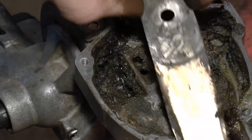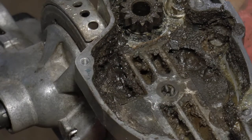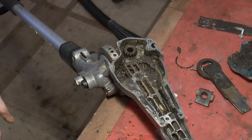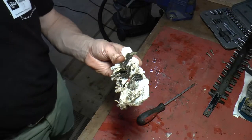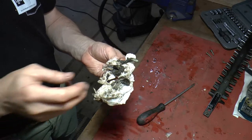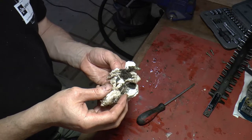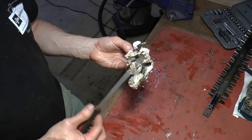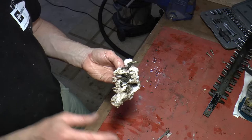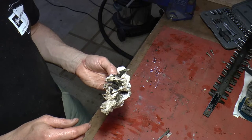This is all quite simple. There's actually another metal plate underneath, so we'll take that out and clean everything up in the parts washer. There are some more bearings that have fallen down in here so we're going to get those out. This is some of the black grease I've been taking out of the gearbox - it's obviously burnt, it's got bits of metal in it. It's supposed to be a nice creamy colour but it's never been changed. I'm scraping out most of the grease with a screwdriver first so as not to contaminate the parts washer fluid.